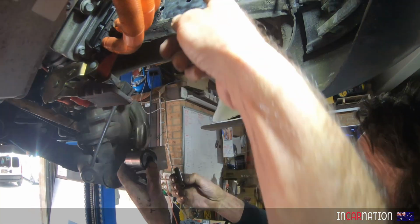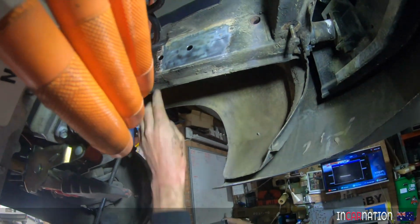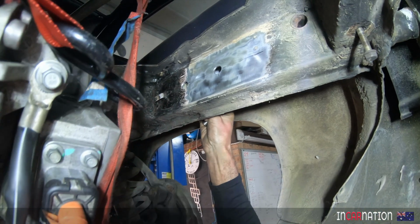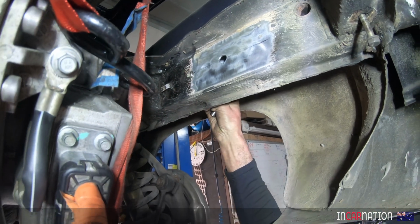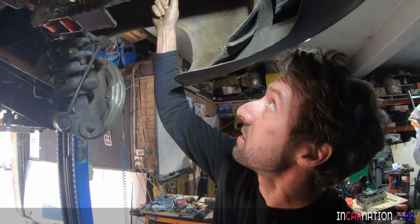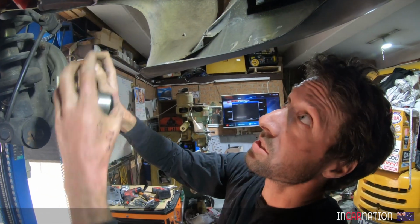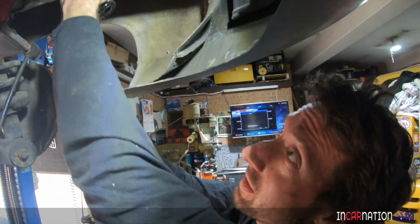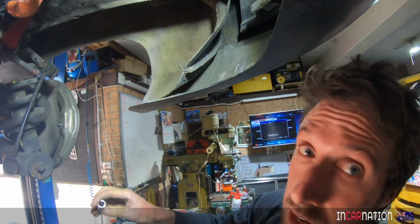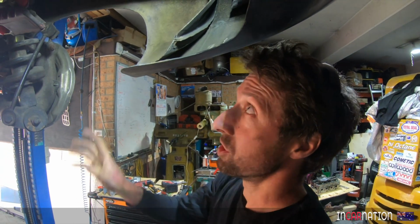How will you attach that to the chassis rail here? We'll put a plate over that, and we'll put some crush tubes in there, like that. And these will be welded to both this side of the chassis and the outside. So we're actually using the whole box section. If we put a bolt there now, we'll make like that in no time because they're so thin. Oh, it'll bow? It'll bow. Yep. We'll just crush the rail.